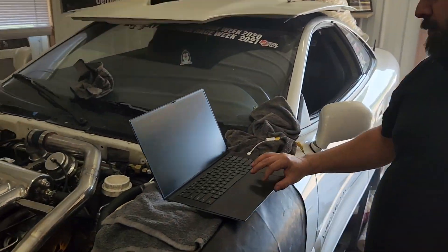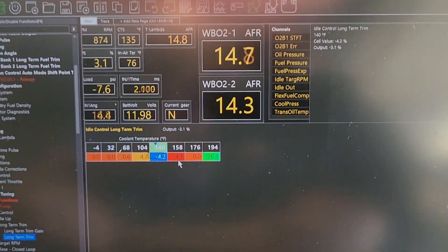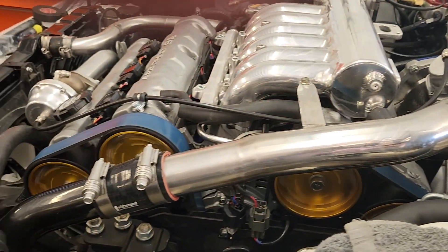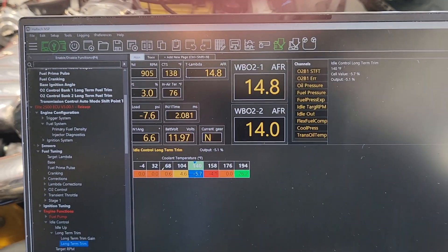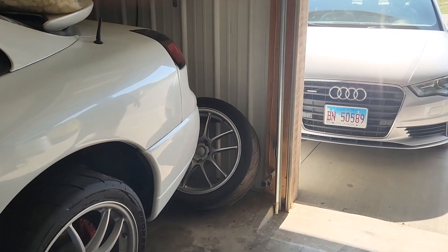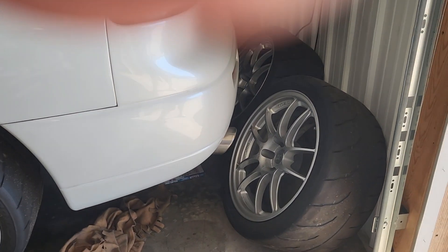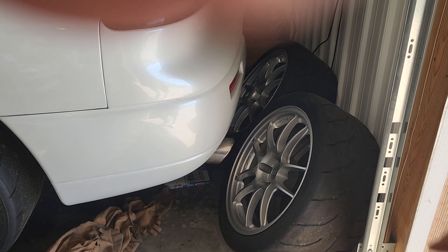You can see it's starting to adjust the idle trims a little bit. Since we went to drive-by-wire, none of our idle data is correct — that's why it was so hot. See that moving? It's slowing the idle. You can also see our timing belt is probably a little tight; we're gonna back off on the adjustment on that. It does sound like we got all six cylinders. That little bit of choppiness is because of the cams, so that's actually pretty good.